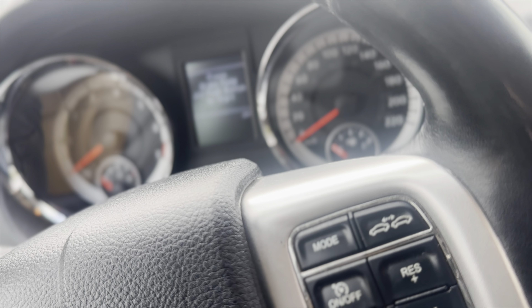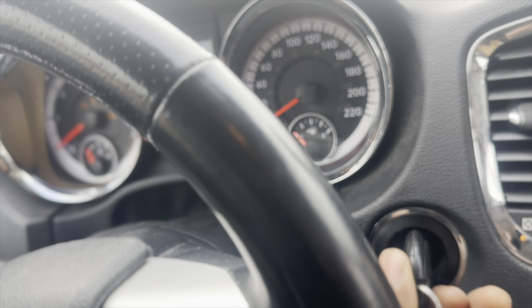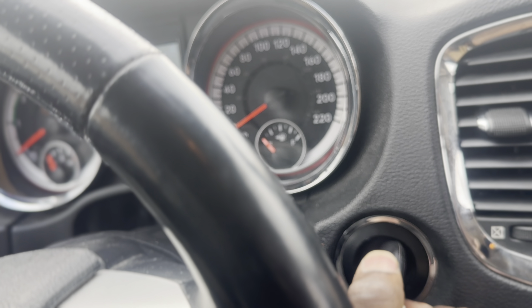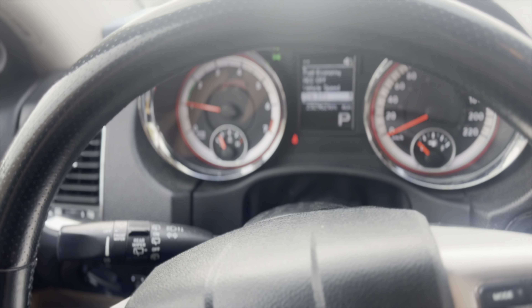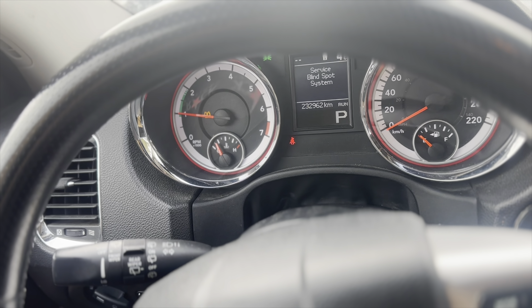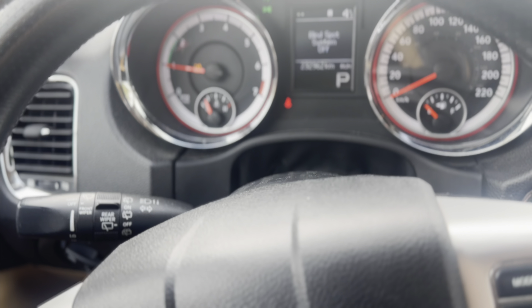That's not it. What you do is: look at the key fob, look at the hole. You put your key inside the hole, then press your brake, and turn — normal — and everything activates. And that's how you start your 2011 Dodge Durango to 2015.